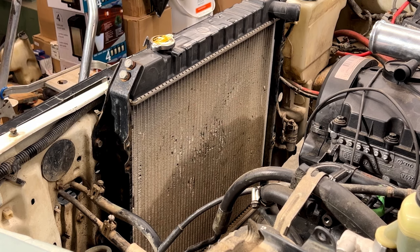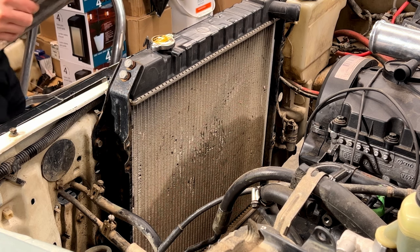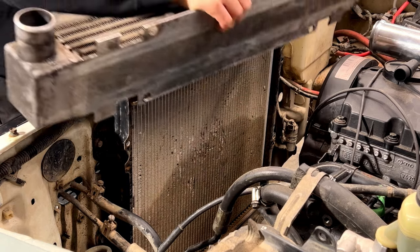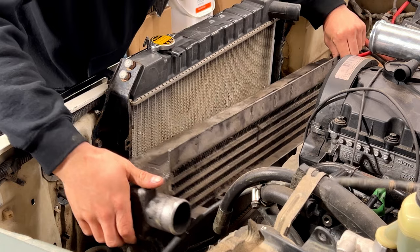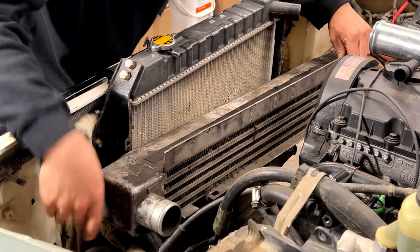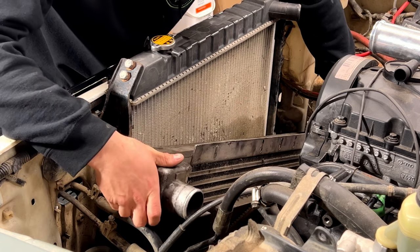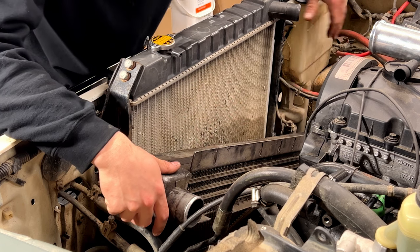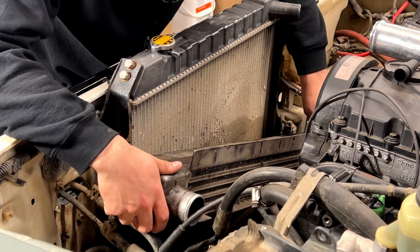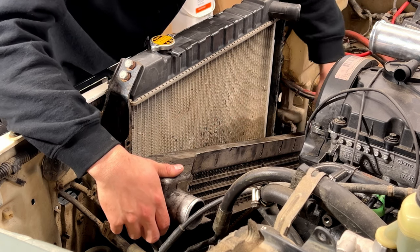I've got the camera zoomed in and I'm just going to hold this intercooler up. It's also a little bit too deep — see how it doesn't fit in there nicely? It's hitting the power steering cooling lines, it's hitting the cab with the body over here. We'd have to do quite a bit of cutting, moving steering lines, moving this reservoir. It's just not going to fit in there nicely.